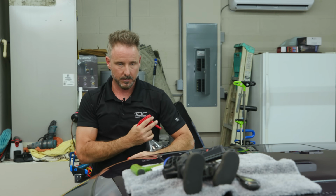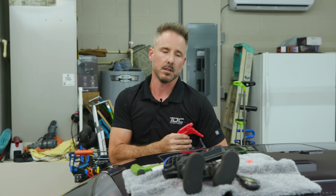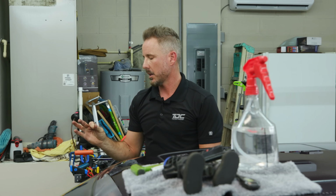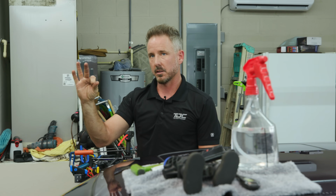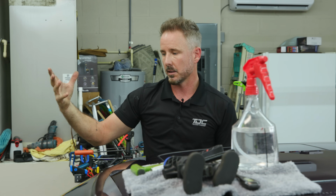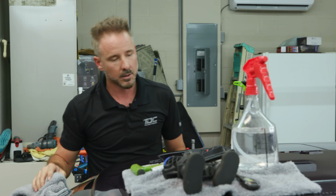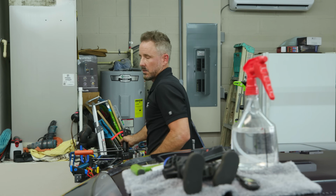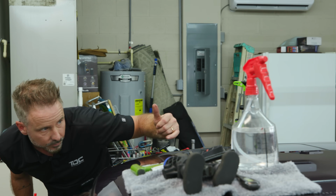Dents are never just the center of the dent. If you see these dents and they say, oh yeah, I've got a dime-sized dent, a dime, by the way, is 0.75 inches. That's the center of most dents, and you could see a dent that has a center like that, but the dent could actually be that big. So you work around the circumference. You've got to look at where the edge of your circumference is. In this case, you did a good job at getting it picked up on video.